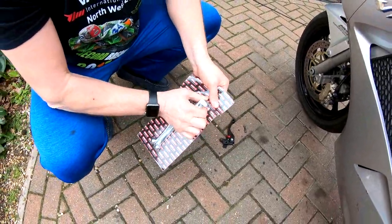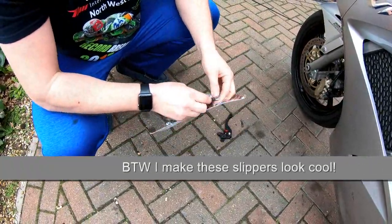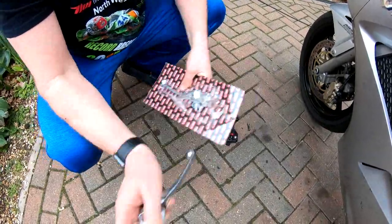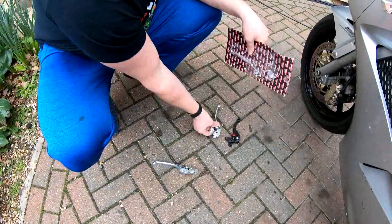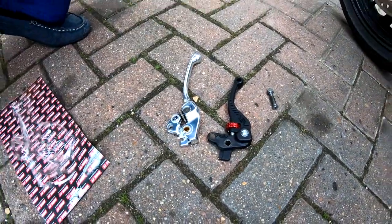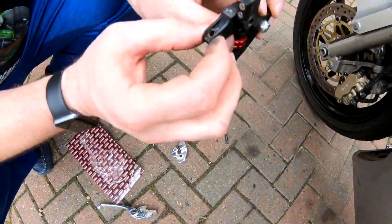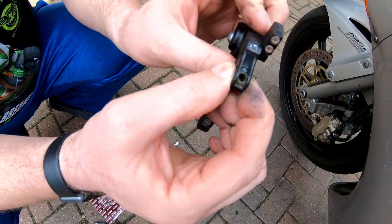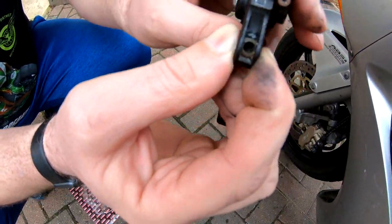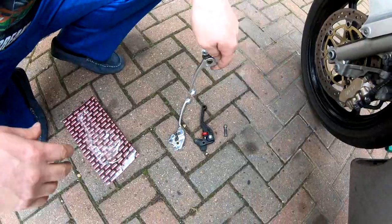Let's take them out of the packaging. That one's clutch. As you can see, the linkages are very similar. This little pivot pin here meets up with this here. There's a small hole inside which keeps it — as you can see, as the lever moves around its pivot, that pin will remain engaged with this. We'll have to swap that over to the new one. And that one's the brake lever, so we'll put that over to the other side.